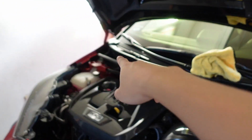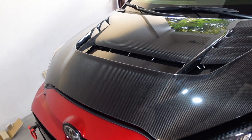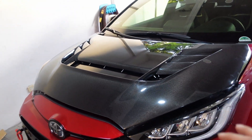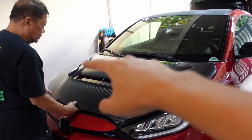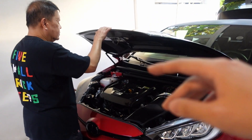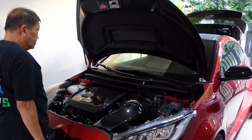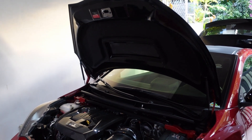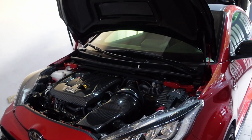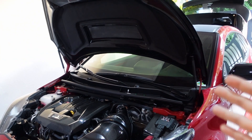Since we have another damper, why not use it — the mount is already there. We've installed two dampers on both sides and they open pretty aggressively, so you really have to guide the hood, just like how my dad did it. So for those of you who own a Varis hood and don't want to use the weird hood stand that was provided, we can afford not to use that and stick with the hood dampers.